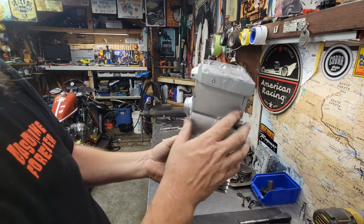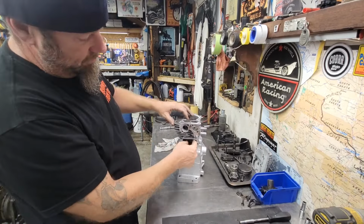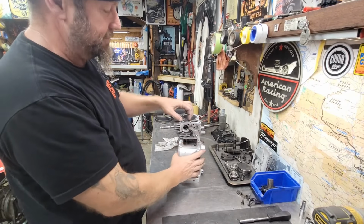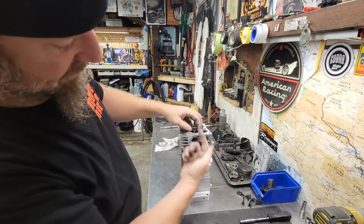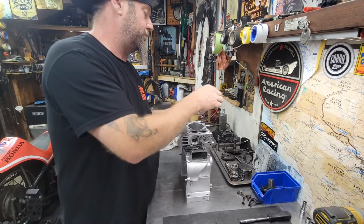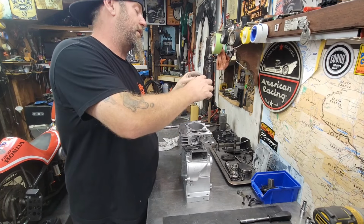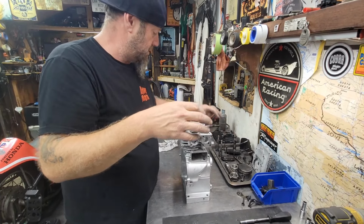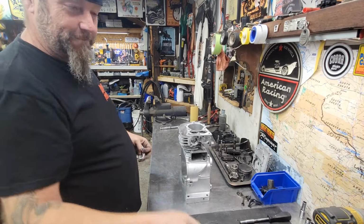That's really another reason why I love them. So nice and easy. Get the valve back out because the valve drops around the spring, so now the spring can come out because the valve's out. Put that all back together so we don't lose our parts and pieces. Blockzilla on the way, guys.